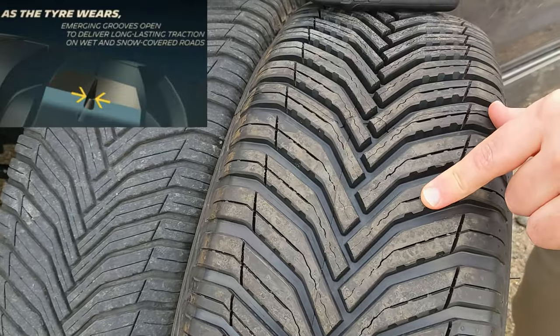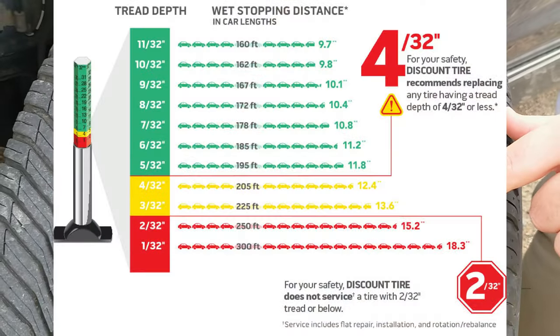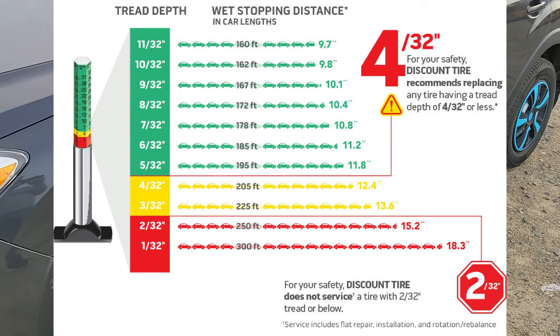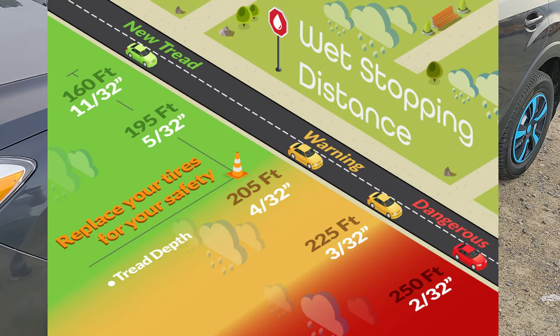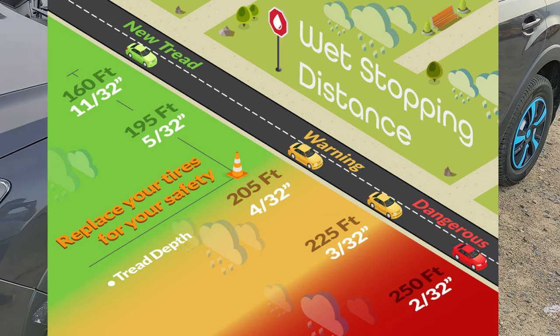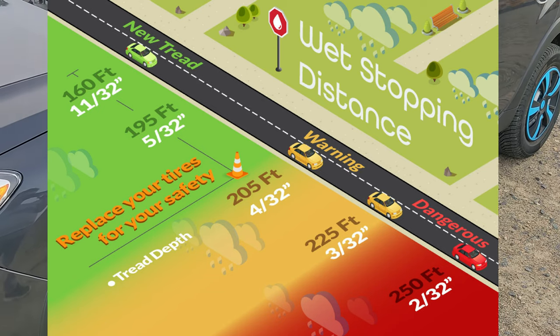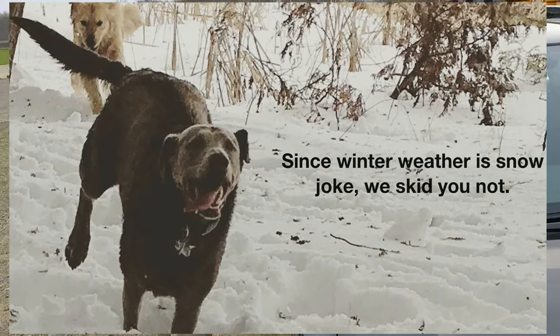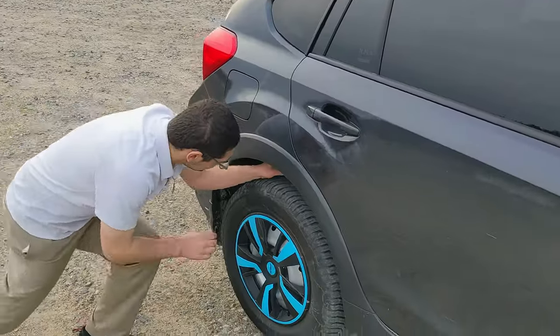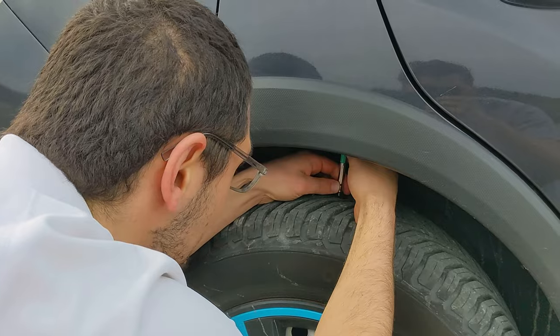There's this claim in the comments that these tires are good all the way to 2/32nds. You don't want to be doing any bad weather driving with tires down to three or under 4/32nds. It's just not a good idea when you talk about snow, any degree of ice, even harsh standing water or pouring rain. Going to the rear tires, we're seeing 7/32nds as well.